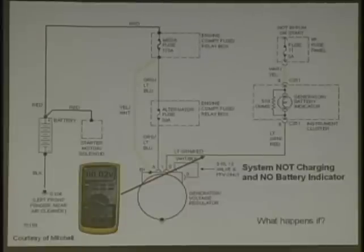What are multiple things that can be wrong with this? The light is not on. The vehicle is running. The 5-amp fuse 11 blown. That won't even power that. What else? How about if the bulb was blown? Sure. And the resistor? No, because the resistor is still in the circuit. Good. See that?